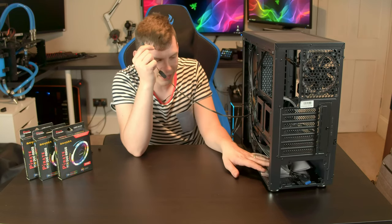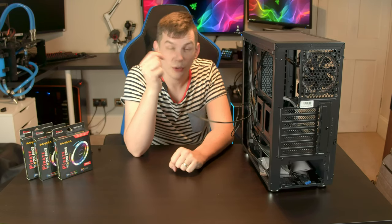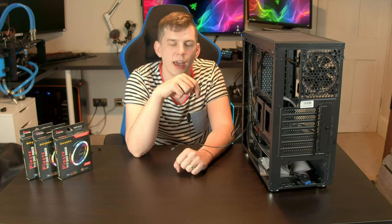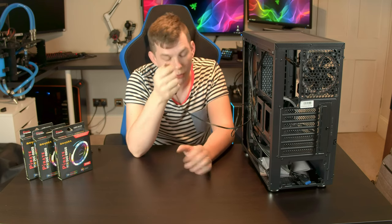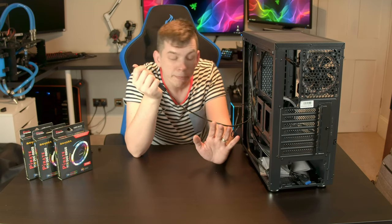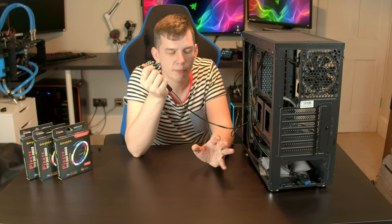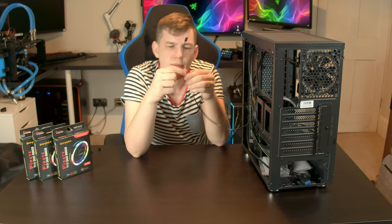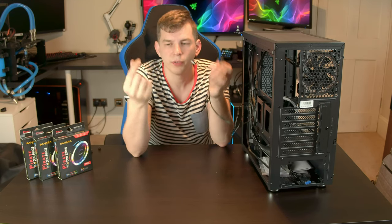The controller is Molex powered, not SATA powered. It's not the end of the world, but in 2019 it is a bugbear of mine - I hate seeing Molex connectors. To be fair, you're probably going to be running a fully wired non-modular power supply in this anyway, so it's not too bad. But why can't we just have SATA? It doesn't cost anything extra.